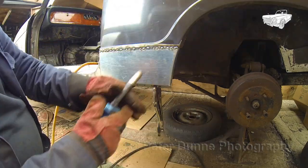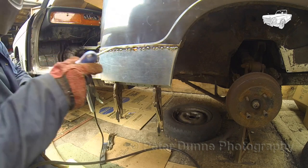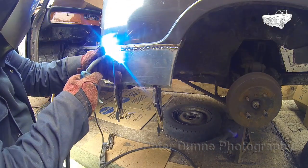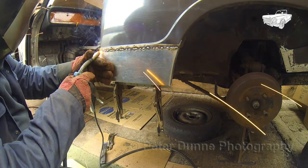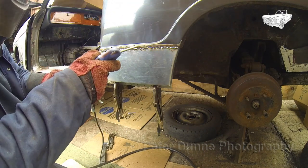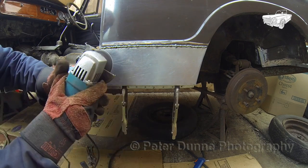Spread the spot welds out and stop to allow each weld to cool before welding the next spot. You will need to leave a 1mm gap in the joint, which should give you a much better weld penetration. If you have an air line, cool down each weld with your blow gun until eventually the whole joint will be welded without any distortion. Then you can sand down the weld with a 36 grit disc and finish off with an 80 grit disc.